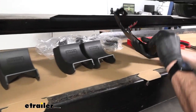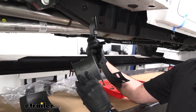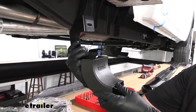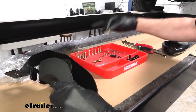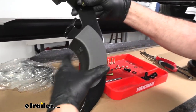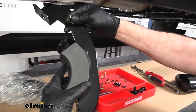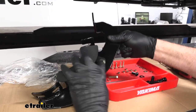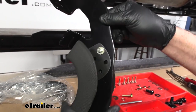We're going to install the bracket covers loosely on the brackets. When hanging on the truck, they basically cover up the gap between the Nerf bar and the frame of the truck — it's just a nicer look. These install with the included hardware: take the smaller metric 6 cap screws, one flat washer, and a nylock lock nut. The furthest hole on the bracket covers lines up best on our truck, so thread the cap screw through and thread it on finger tight for now.